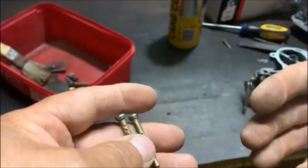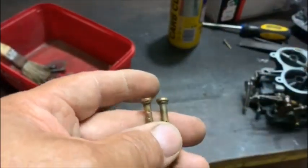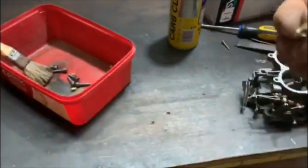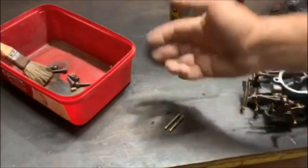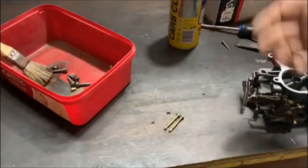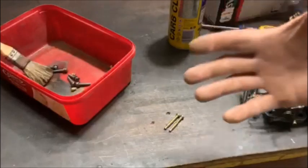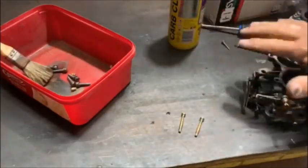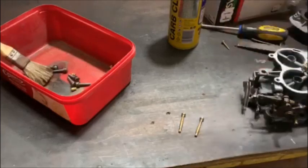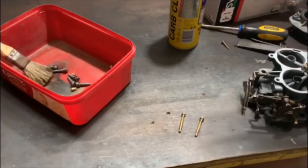I don't have two F66, but I'll turn these two around, put them back, and try them, because they are F50 and F6 for a 1500 and a 1600 Kent engine. Don't know how much different that'll be to an A14, but I'll put it in like that and try it. That could also be a major problem, but we'll see. I'll put it back the other way around, put it together, try it and see what it does.